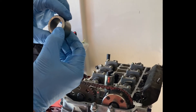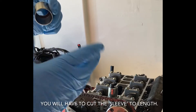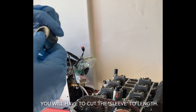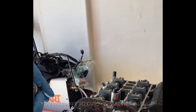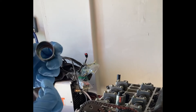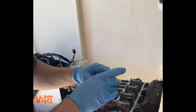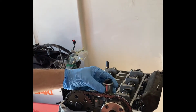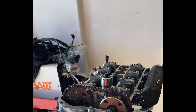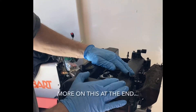What I came up with was basically taking apart the VVT from the 2.3 and making a sleeve out of it. I knocked the guts out of it — there's a crimp on the bottom I opened up with a flat screwdriver and drove all the innards out. I ended up with this little sleeve, and this guy slides right onto the new VVT.